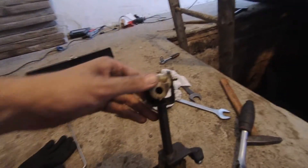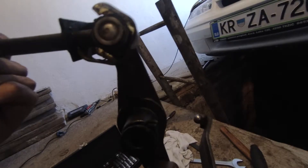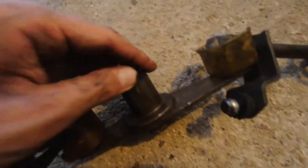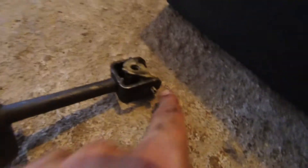Here's the old rubbish. Now I'm gonna replace everything and put on the short shifter. Take off the c-clips with some pliers, take out the bushings, take out another c-clip, and get this pin out for this bushing.